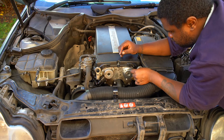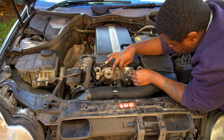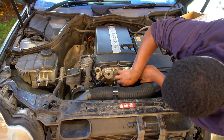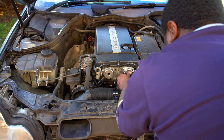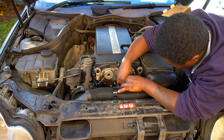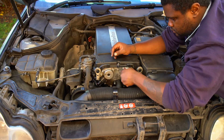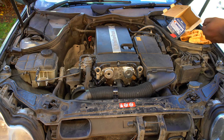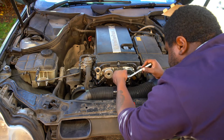Put them all in going in at once, because you don't want that O-ring not sitting in its position. Just push this in and then tighten these by hand for now, because I don't want that O-ring moving around. These are only 10 Newton meters, so you don't need to press them that hard — you don't have to force it. It's only 10 Newton meters of torque; they don't have to be super tight. Otherwise, this is the aluminium head, and if you force matters you'll find yourself in more serious problems.